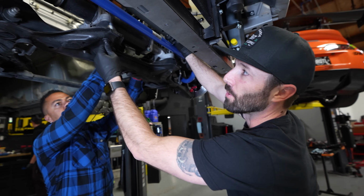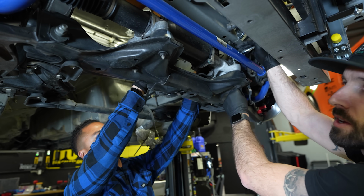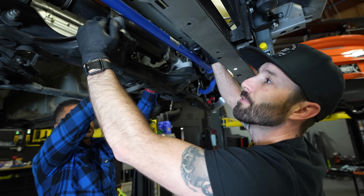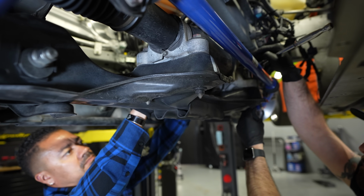And they give you longer bolts. So we have two long, what are these? These are probably M10s, M12s. You'll pull these out, put a spacer, raise your steering rack up like, looks like about 5/8 to 3/4 of an inch, and that brings the whole steering rack up.